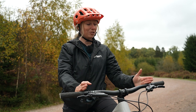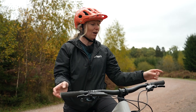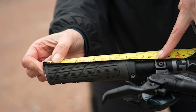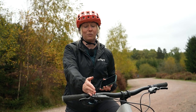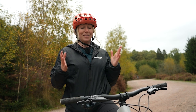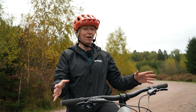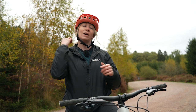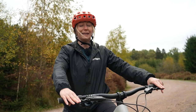Some people like to get their levers completely even and level, and I'm one of those people. I will measure from the ends of the grips and make sure that my brake levers are exactly the same width from the end of the handlebars, and I'll also use a little app that measures the degree of the brake levers so that they're both exactly the same. However, I'll note that not everybody's hands are the same — some are slightly bigger — and it might not feel right to get them perfectly mirrored on either side. So if that's the case, maybe just close your eyes, get your hands in the right place, loosen the bolts, get them feeling right, and then tighten them all up.